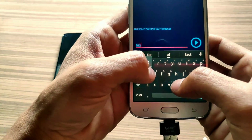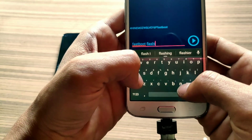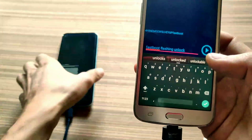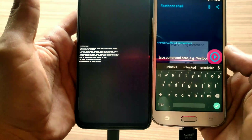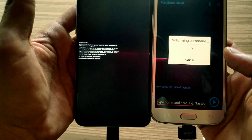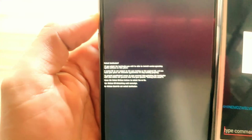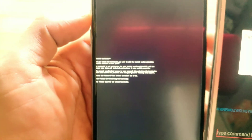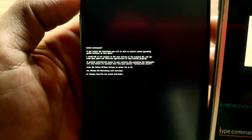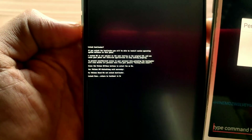You can see my device is connected. Now type 'fastboot flashing unlock' to unlock its bootloader — I will also give these commands in the description. You can see a popup on my Realme 7 saying volume up for unlocking bootloader and volume down to boot in main system, so I pressed volume up.